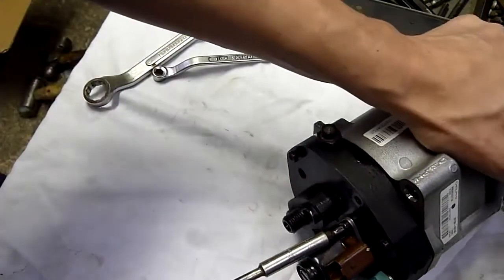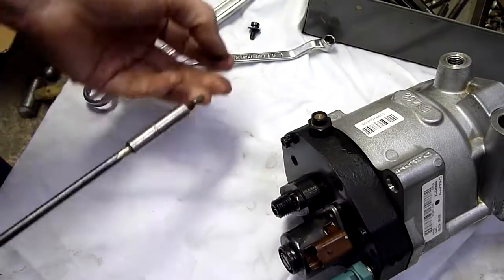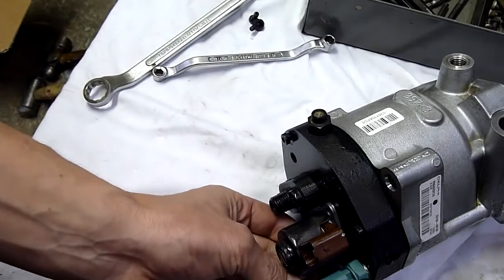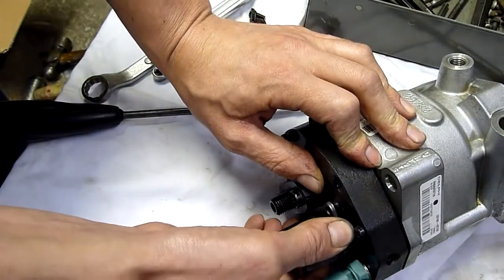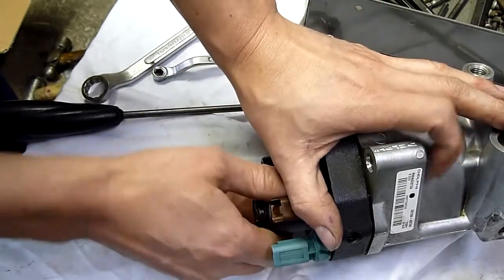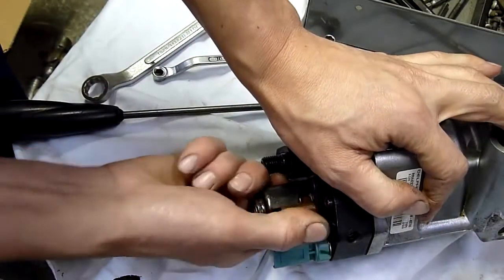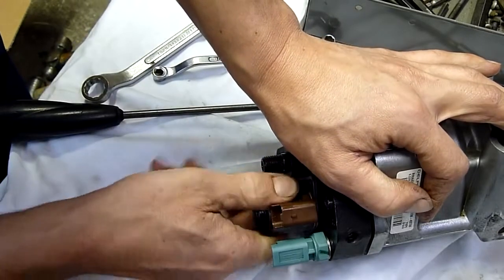Let's take this little gadget off the back. He's had a bit of fun with the car — his missus hates cars that break down, so he's mostly getting a new car because she just doesn't want something that's going to do this kind of thing again. It just turns into a money pit. It's not Hyundai's fault, it's not Kia's fault — the whole system is made by Delphi. Delphi do pretty good stuff, but a lot of these early 2000s common rails have major problems with our fuel. There's a seal holding it in.